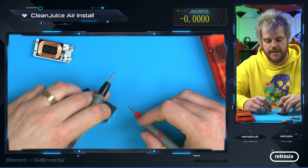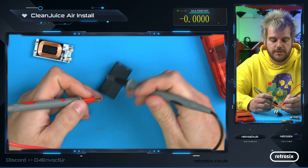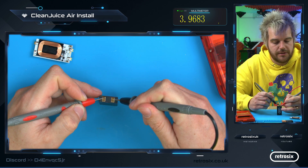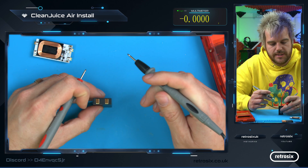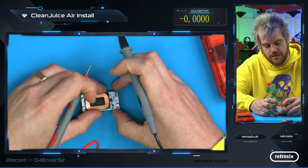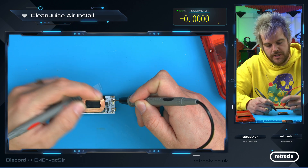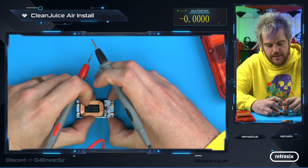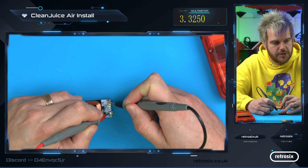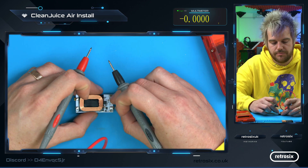You can also test the battery directly. Ground is at the top, positive is the bottom — check that your battery has voltage. If this reads zero volts, you know it's a potential battery issue. If you have 4 volts on the battery but when it's in the console you don't get voltage at the output pins, it means there's no contact. Once it's in the shell and making good contact, you can see the power then goes to the board.